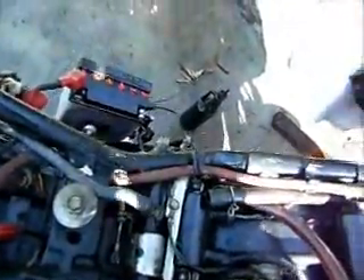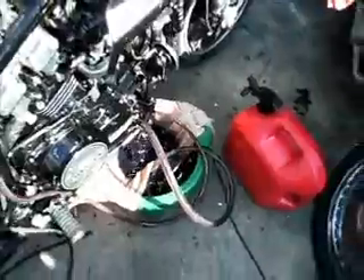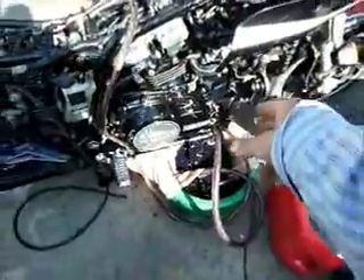At the top of these valve covers on every bike, there's a manifold. I suppose it would help if that hose was not kinked, eh? Oh, now it's draining better. That mixture there is five gallons of diesel fuel and nine quarts of Marvel Mystery Oil. I'm pumping it down through there, it's coming out nice right through here. That actually comes right out of the top of that valve cover in the back there.